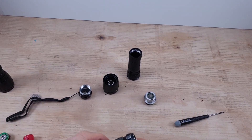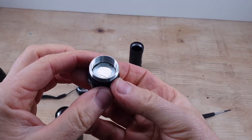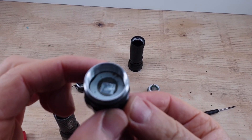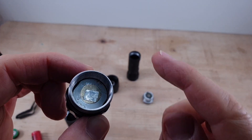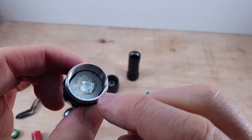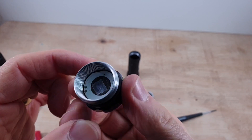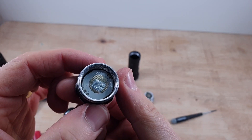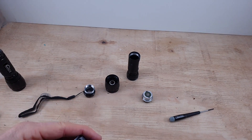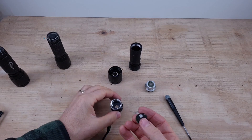Now, if you don't like soldering, or you haven't got access to a soldering iron - this one's nearly 10 years old - all that is is a bit of tinfoil that I superglued just along one edge, a very small part, and then folded it down so there's more contact area of the tinfoil. And so that's been doing the business for nearly 10 years. So you don't actually need a soldering iron, but if you can, it's a bit of a neater way of doing it. So that's that switch taken care of.